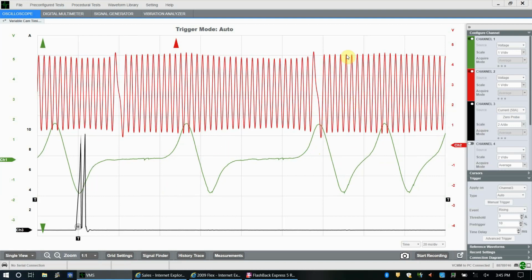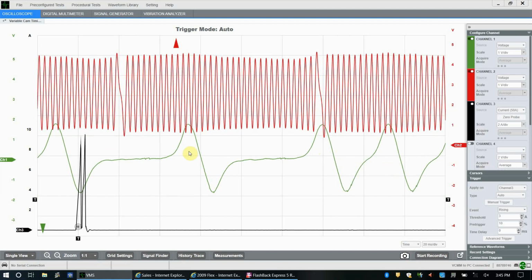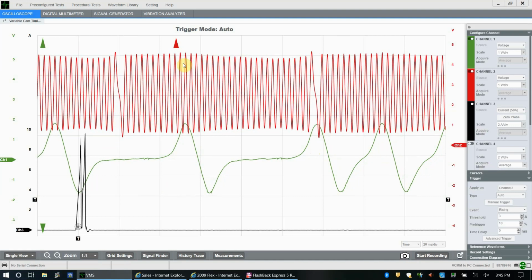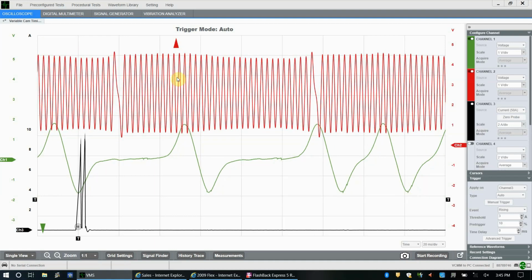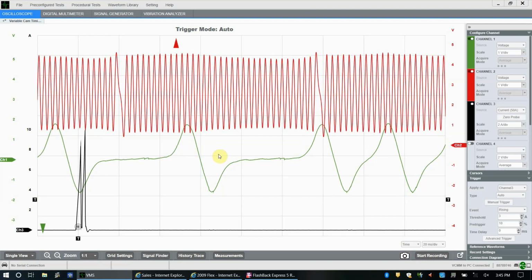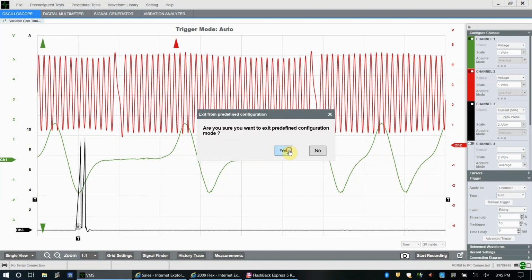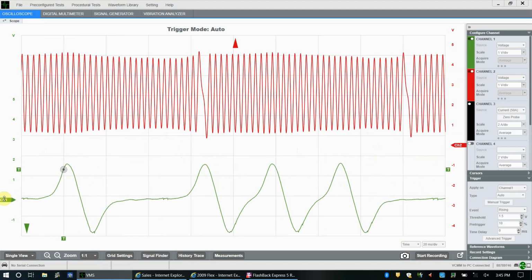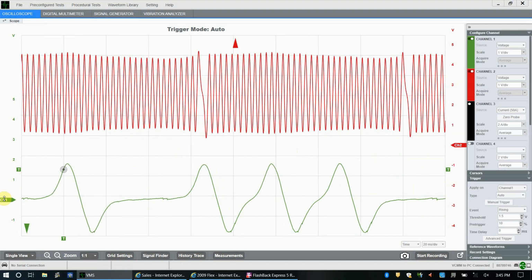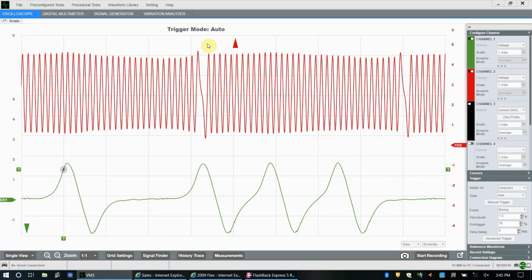This pattern up here is not what we're looking for, and you could be led astray if you're running into, let's say, engine rough run issues or whatever. If you're in the wrong pins, you're looking at the wrong pattern. It could lead you astray. I know on this vehicle, this was how I originally had it set up, actually, in the wrong pin, and I was looking at this red pattern right here, compared to the green pattern that we should be seeing. Compared to that green pattern, I knew that I was in the wrong pin. I knew something funky was going on there because the engine's running right. If it had this as a signal, it would not be happy, right? It would be setting codes.